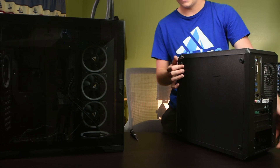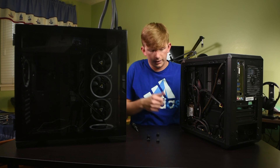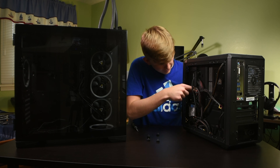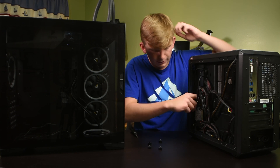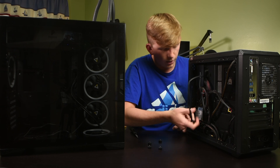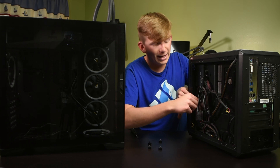I'm going to remove the back panel and take off all of the drives. We're just going to detach all of the SATA cables and power connectors right here. It does take a little effort to get out, so if you do have to pull a little hard, don't worry about that — you aren't going to really break anything. The cables are just meant to be a little snug so they don't pop out when you're playing a game.